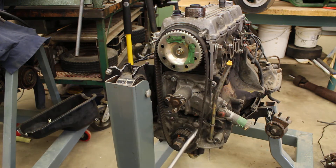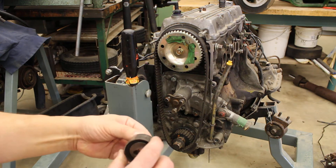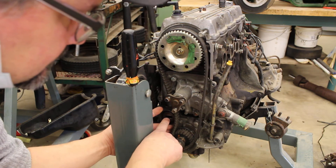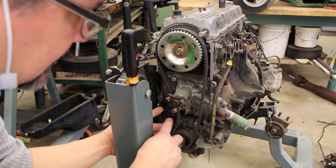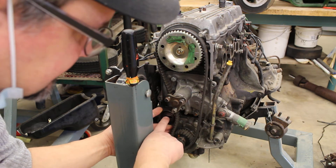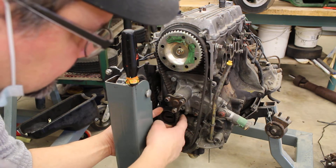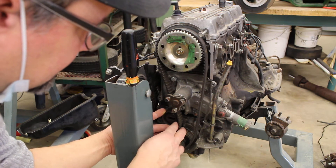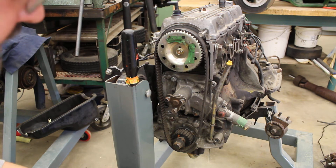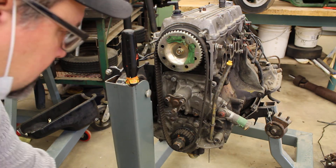You can see the toothed belt and the tensioner, which on this one is separate — right here. It's slotted on the back and installs down in here. Notice the slot in the face — this tensioner does not self-adjust. It would have been a maintenance item on this car: remove the covers, access this bolt. There's a spring in here with a little pin, so there's spring tension. You loosen the bolt, let the spring pull the tensioner in, then tighten it again to compensate for belt stretch as it ages. This is not a convenient system and is easily forgotten, which could lead to belt failure or belt skip — either of which is catastrophic for your motor.